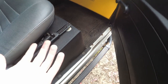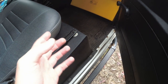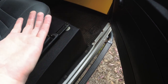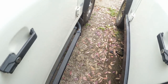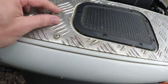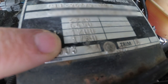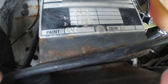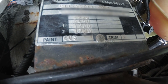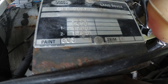Maybe the respray is a really great one — resprayed in a factory colour, not obvious to spot like yellow, and maybe it hasn't started wearing. What can you do then? Well, for later vehicles, from the 2000s onwards, you can come and look at the VIN plate and look at the paint code here. We've got 603 — I can tell you that's Sonar white. On LR Workshop there is a list of paint codes, the link is in the description, where you can come and check this against the paint codes.